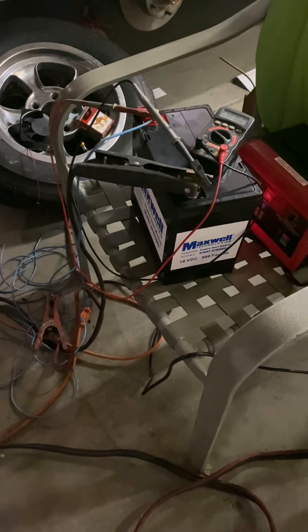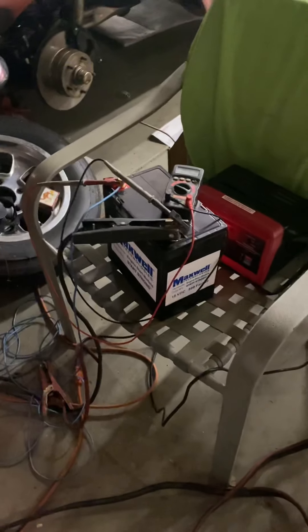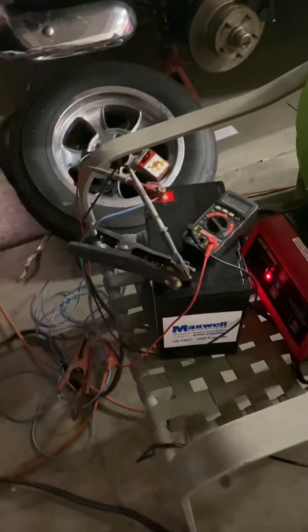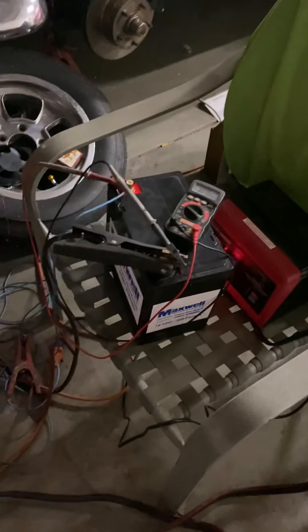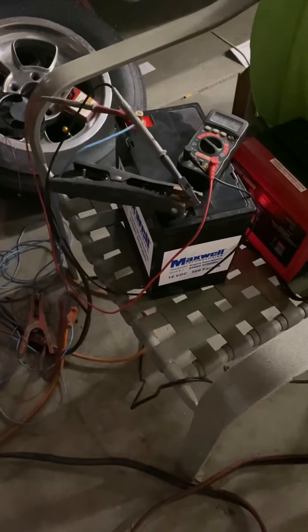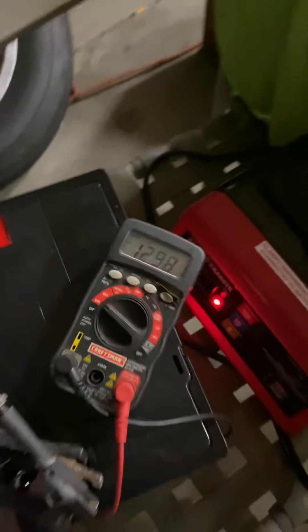Hopefully this works. I've got a 4500 watt amp coming in the mail, and I don't know if that's going to be enough or if I'll just hook a battery up to the other battery as well. Either way, this is a super simple way to charge your Maxwell capacitor — 500 farads. You can go up to 16 volts, but I'm only going to go to about 13.5 or 14. Almost at 13 now — I'll call that good.